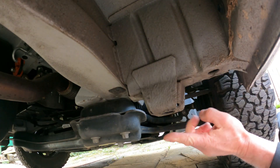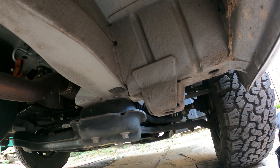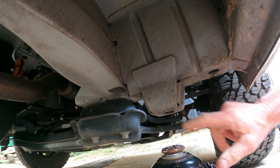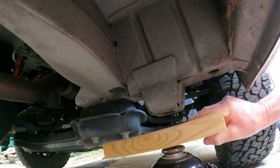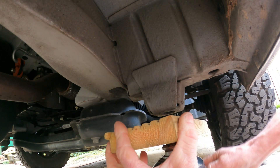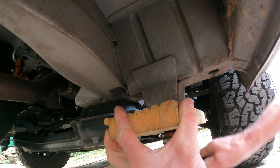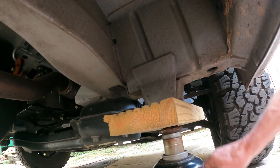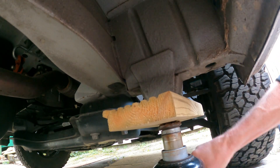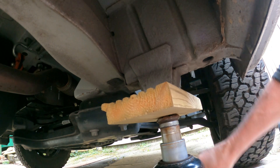So basically what you've got is the jacking point there for the scissor-style jacking. I'll just get my bottle jack in there in the position of that one, and then I'm just going to put this little bit of wooden packing in that I use, and get it directly in the spot I need to jack up. This is like a two-stage jack, so that'll pop up in a minute - just meet the top of the jack when he starts taking a bit of weight, he'll just pop up.